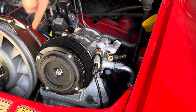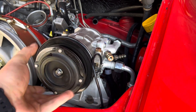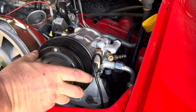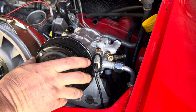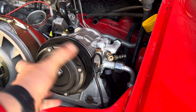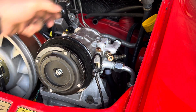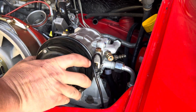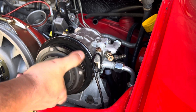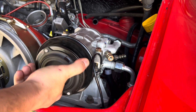Those three are tight. The other thing we want to do — because we drained and then refilled the compressor with the oil we want to use — is turn this around about a dozen times in the direction of rotation. All that's going to do is push the oil through the high side, the discharge side. Right now it's probably all sitting in the bottom loop of what goes up to that rear condenser.